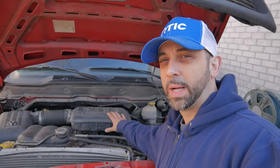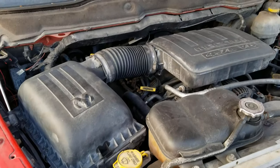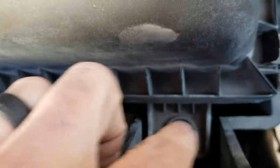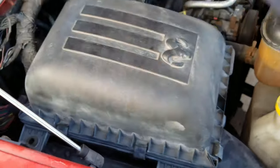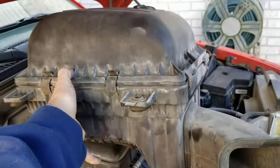You pop off this top here — it's underneath it, got one screw holding it in. You can pull it out, clean it, pop it back in, and we're going to check if that's what fixes the problem on this 4.7 liter Dodge Ram. It's real easy. All you do is loosen up this band — it goes to your air box. Your air box goes over to little nipples there to hold it in place, just pull it out. It should just lift right up and you can pull it right up out of the area.